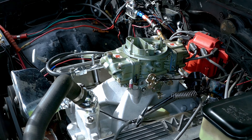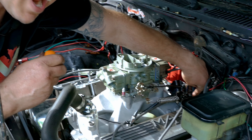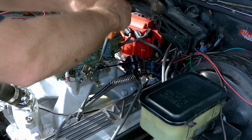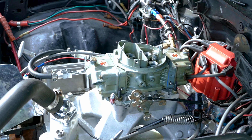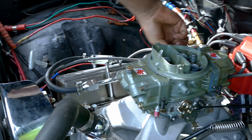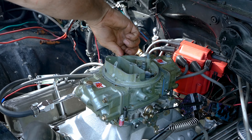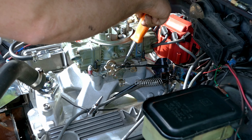So you'll see here, we already did a couple of things and eventually we got it working okay. It still needs a lot of work. I took a jet out of it, played with the squirters and tried to get it to move a little better off the line. But I'm going to tell you right now, I think the main problem is it needs a new fuel pump. And the last owner put the fuel pump on first and then put the filter second, which has to be filter then pump. So he has that backwards. There's no telling what's in the pump, what's clogging it, but it's making no pressure for fuel.